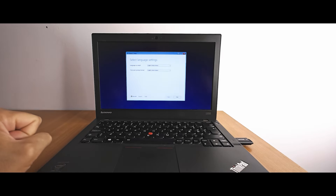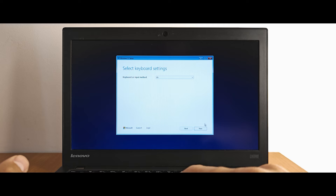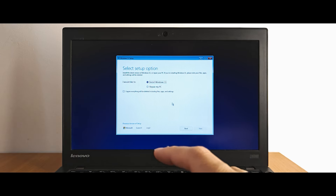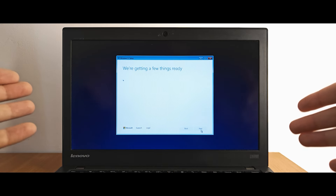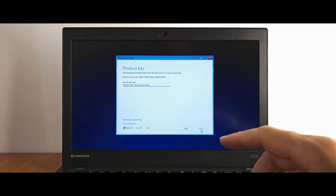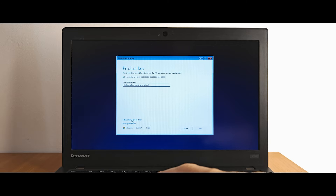I'll change the angle. By default we see English United States — just click Next. Keyboard layout will be US. We have the option to install Windows 11 or repair my PC. Right now this laptop has Windows 10 installed, so I'll click 'Install Windows 11'. We need to agree with all terms and conditions and click Next. We're getting a few things ready. In the next window we need to enter a license key, or select 'I don't have a product key' to activate Windows later.